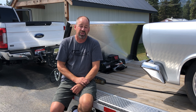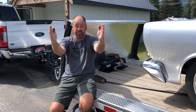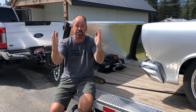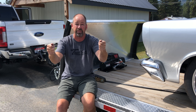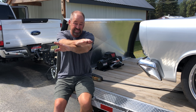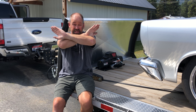Thirdly, the reason that we don't recommend crossing the straps is that if the straps are positioned straight away — and this has much more to do with the rear of the car than the front — they're already prepared to do their work: hang on to the car and not let it travel forward on the deck of the trailer. If they're crossed, they have to actually straighten out to a certain extent to begin to do their job.